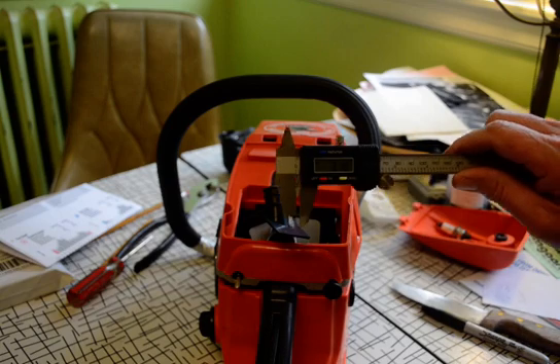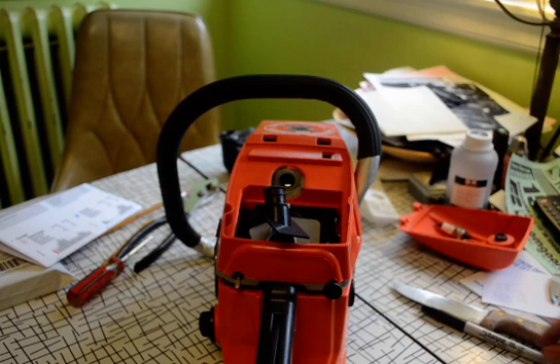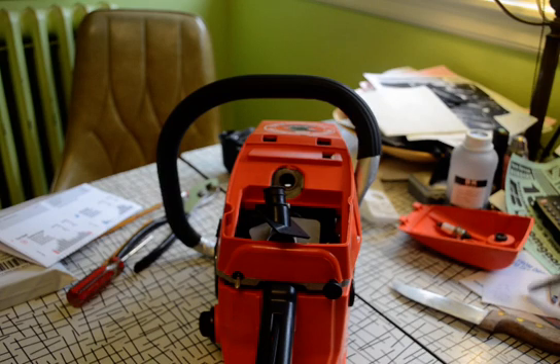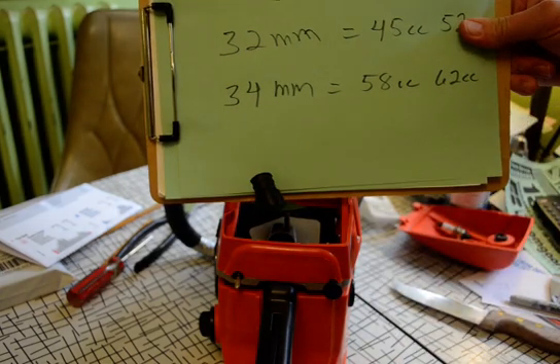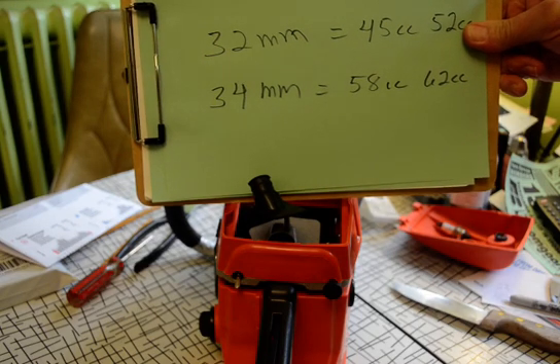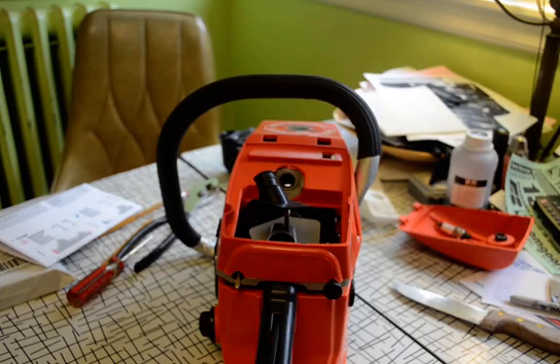You want to use a good digital caliper. I measured this one and it came out to 32.64mm, so I'm much closer to 32 millimeters than to 34 millimeters. So while I'm not exactly on, I am in the range of a 45 to 52cc. Already the 58cc designation doesn't make any sense.